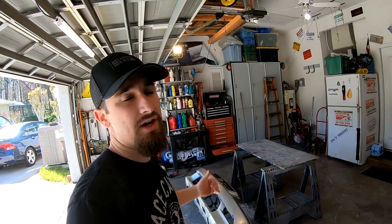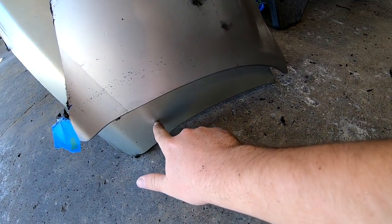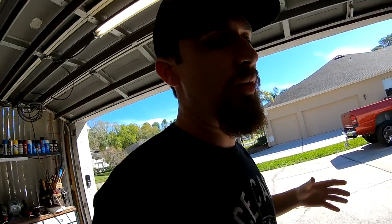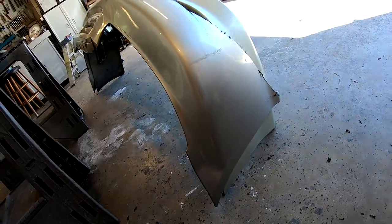So this is what we're looking at — rough cuts out of both bumpers. I took a lot less off each one than I knew I'd be needing, so that way they can overlap. Down in this section is the Integra bumper, and this is the Civic bumper — the vehicle is obviously a Civic. I wanted to make sure to keep that wheel arch. If I'd just done a line straight across and tried to sandwich one on top of the other, I would lose the arch and it wouldn't be right. That's something you've got to consider — you've got to think three steps ahead of your work. Now I'm going to lay them together and start mapping it out to find where the final cuts are going to be.